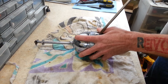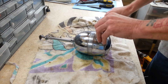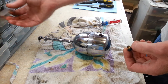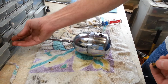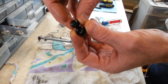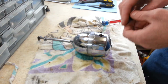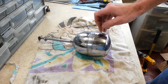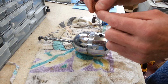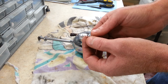Got the right screwdriver and these brush caps are definitely pretty chewed up. Unfortunately these aren't the same sizes as the brush caps I have here, so I do have to order ones. Here's the cap I just took out and here are the caps I have - you can see the size difference. Even on the threads they're just a lot smaller. The brushes appear to be the same size, though this one's obviously short. The springs are a lot bigger and this spring looks like it's been stretched out, but the new brushes come with springs.